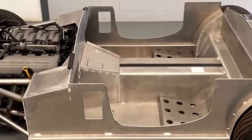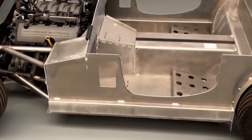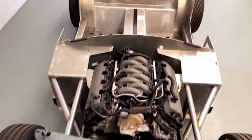So we were forced to have X wheelbase. And then in this X wheelbase, we want to try and put a 6 foot person in. That's immediately a challenge, because at the same time, we want to put the biggest Ford engine at the moment. Realistically, the Coyote is very big. We want to put it in and we want to try and push it as far back as possible because we want the weight distribution to be as center as possible. So now we've got big people, big engine, short wheelbase.